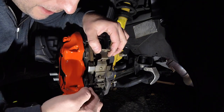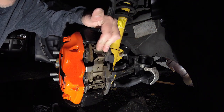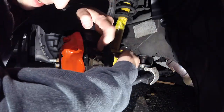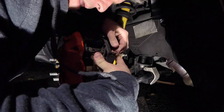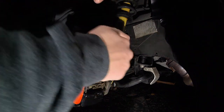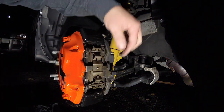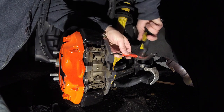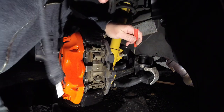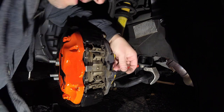Once you have the brake pads back into place, start by sliding the pins in — and don't forget the pins go through the retaining clip. Slide them in and tap them from the back, taking your time and being careful. You can use a punch to get them all the way in and flush. You want to see those pin tips basically becoming flush with the front of the brake caliper. If using aftermarket pins that are a little longer or shorter, just make sure they're seated correctly. The part that holds the entire assembly in place is that clip that goes around the back end of the pin — that little piece of metal that spins around is what holds it in place, so make sure it's hammered in and holding the pin, because the rest of that pin is free-floating inside.